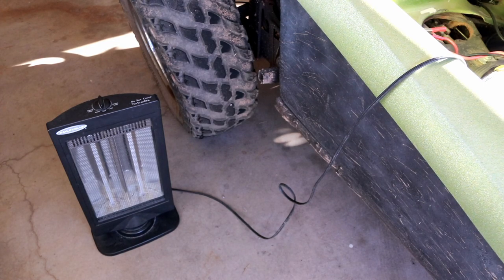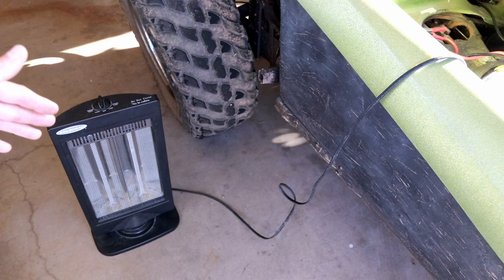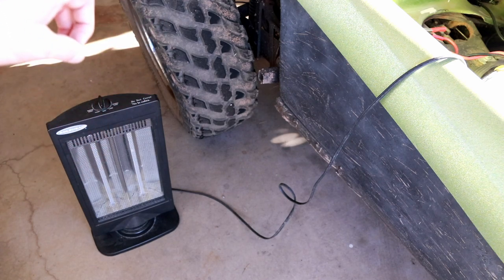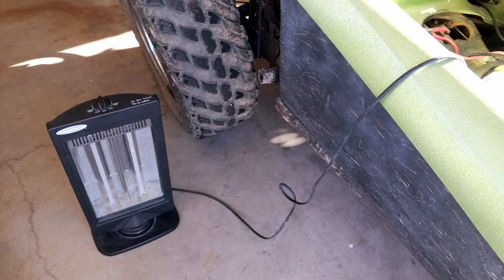So there you go, we were easily maintaining 13.8 volts, which is more than enough to keep the battery happy and charged while powering this space heater. We were drawing 59 amps from the inverter, and we were actually still charging the battery from the last time I cranked the starter, with an inbound current of actually 61 amps to the battery from the alternator.